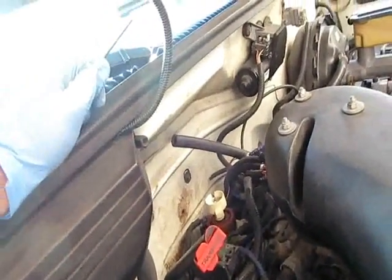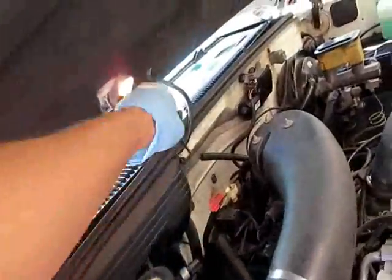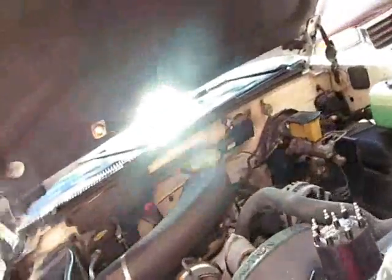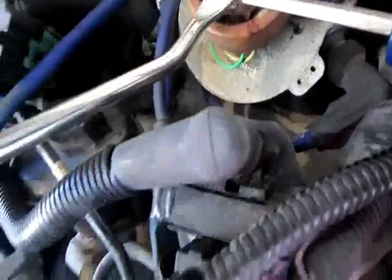Another trick I didn't do last time because I was being sloppy and fast - put your wires, tuck them on the whole passenger side, tuck them. And then the driver's side, tuck them, so you're not letting them down on that firewall like it happened last time. Give it a couple of whacks, try to loosen it up. This is the tool to have - a little body clip tool. Put a screwdriver like that and rest it on. You can just keep prying up on it and it pops up. I've already got it off.